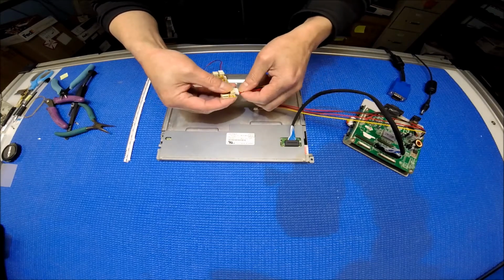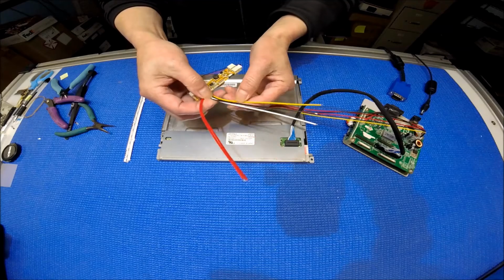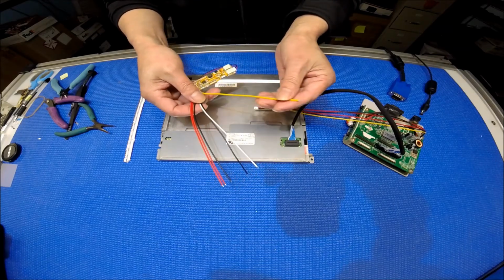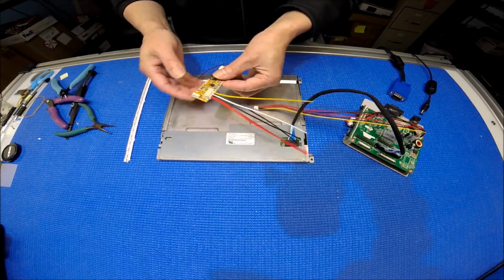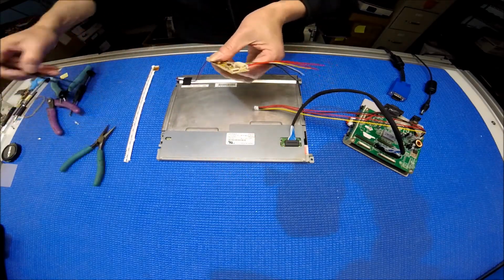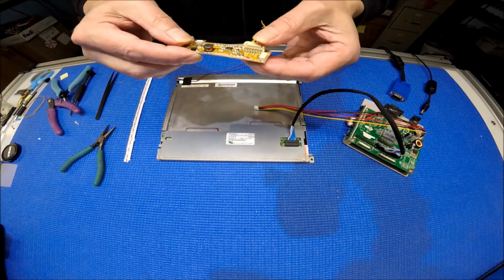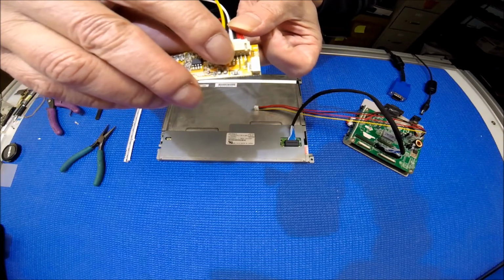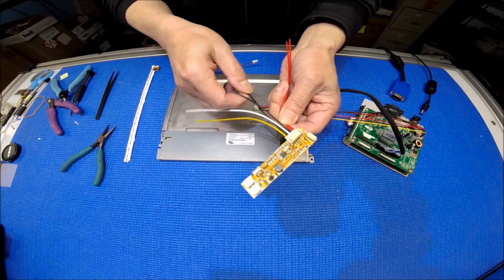When you purchase this kit, it comes with the one 6-pin pigtail. Red is for the input, black is for power ground, and white is for adjustment, usually no connection. Yellow is quite important, and you need to connect between 3 to 5 volts. In case your inverter does not have a 5 volts or enable, there's a really tiny jumper we call JP5. You just short it out and connect the red, positive, negative to it.